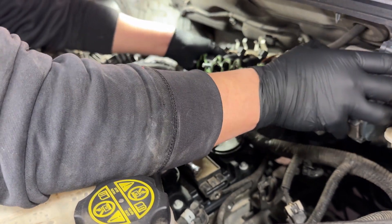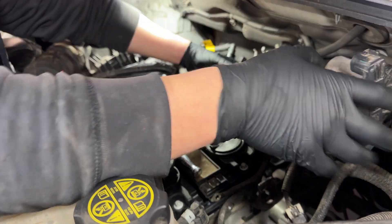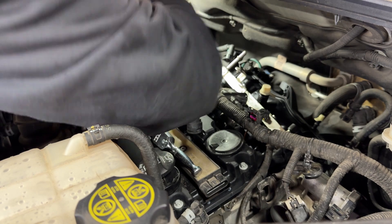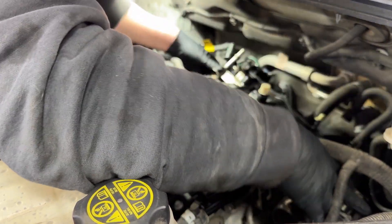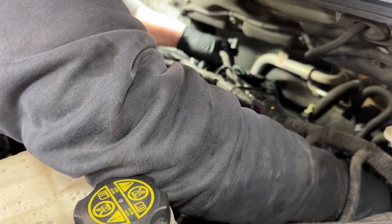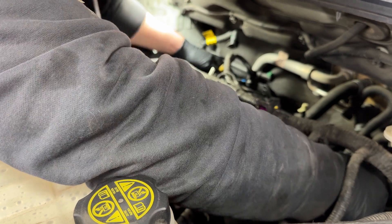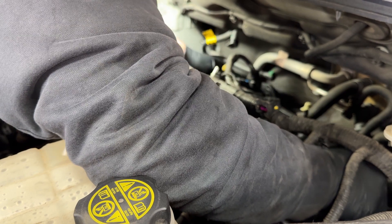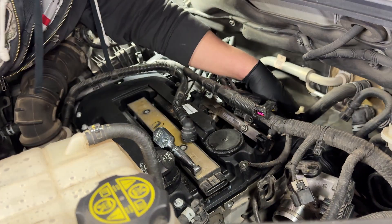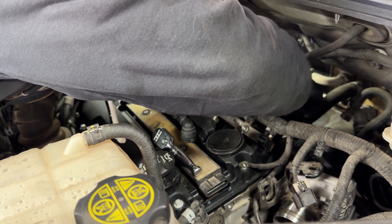Be very careful putting the intake back into place. The bolts usually won't slide out to the back so you should be okay there. Check your harness to make sure you don't get it kinked in, and watch the vacuum lines. Once it's in position, use the E10 inverted torx and hand-start a couple of threads on each bolt to set it in place. It won't fall all the way down because there's a bracket at the bottom. Make sure you don't catch any harness between the intake and the head. Also grab a rag and clean off the mating surface where the head and intake meet.